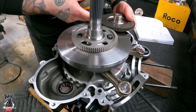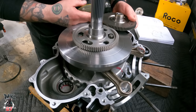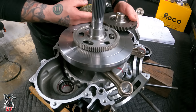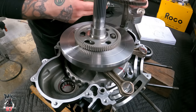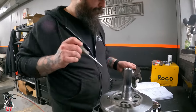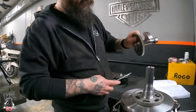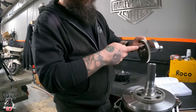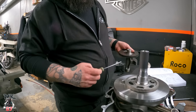There's a spring that sits against this — this is a two-piece gear, scissor gear, or whatever you want to call it. As soon as I get it out of the bearing I can explain it a little bit. Counter balancer in the front, counter balancer rear, and you have your scissor gear in the back here. If you can see the split — you see it moving there — what that does is it puts tension on both sides of the gear, so it just stops noise.